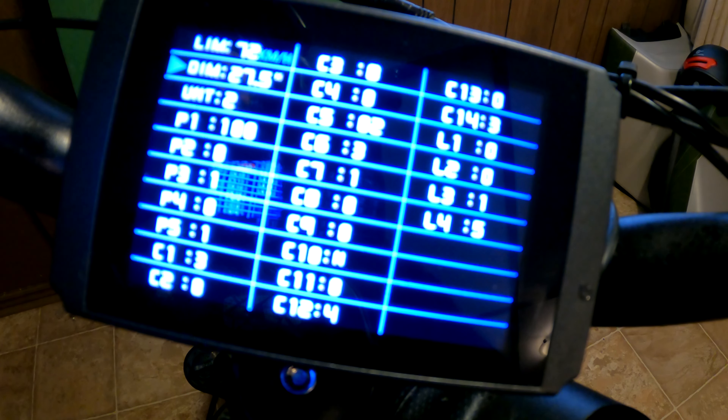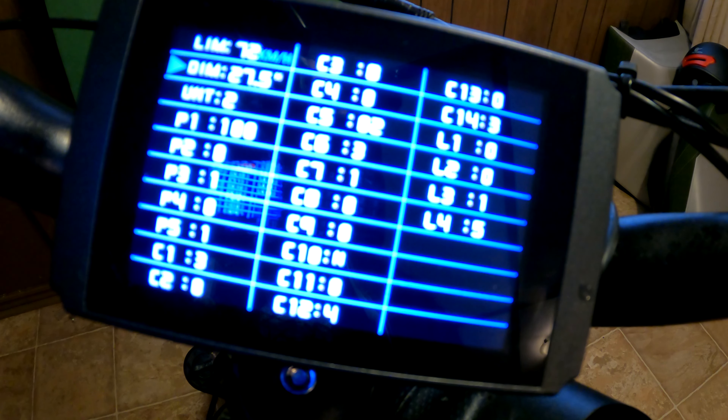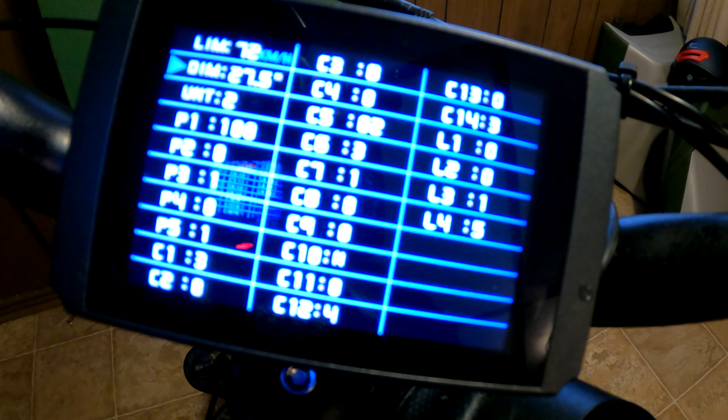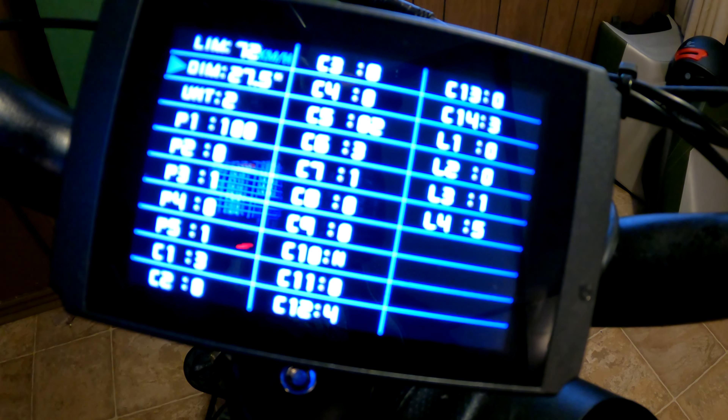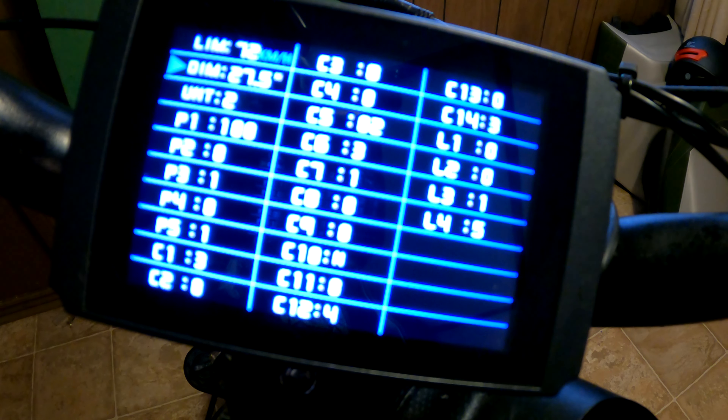Another key setting: once you start playing with this, you'll find your speedometer may not be 100% accurate. The Rad Rover actually comes with 26-inch rims, but because it's a fat tire bike, by the time you add the height of the tire, you're not getting accurate speed readings. What I had to do is bump it up to 27.5, then use my phone GPS speedometer attached to the bike and go for a run — that's how I confirm the speed is as accurate as possible.